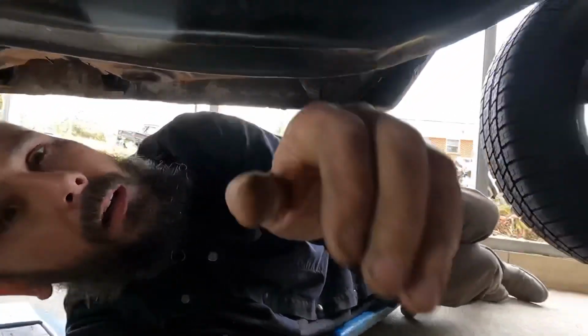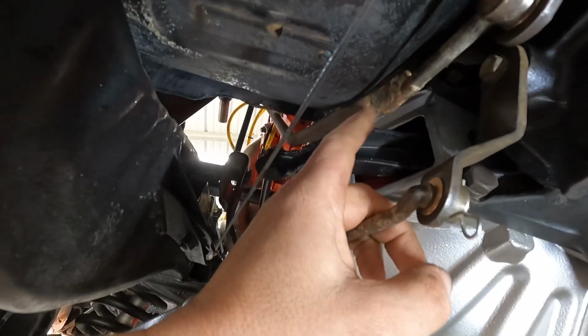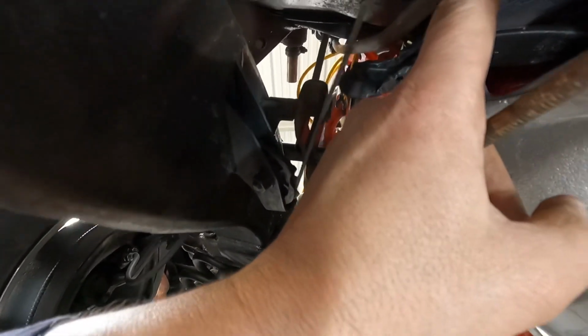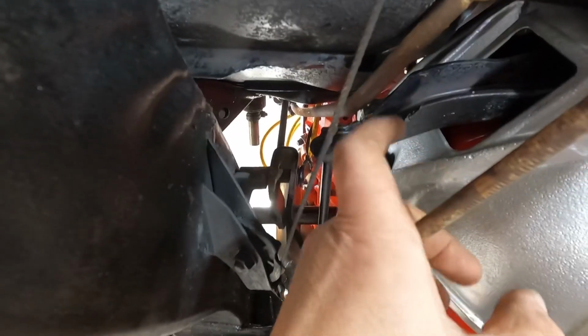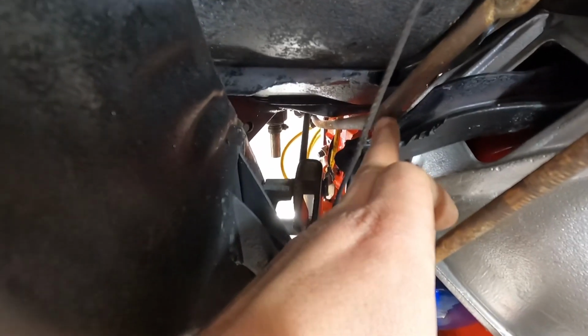And that may be why this rod was brazed like it is. As you can see, it actually hits the floor. Pretty sure it's in reverse right now. But, and I've always noticed this, I always noticed this torched-up clearance on the clutch fork. Well, the clutch fork was clearanced because maybe they've run this style of trans, and it hits the shift rod.